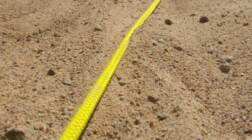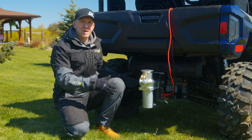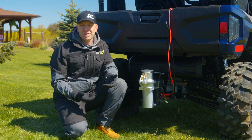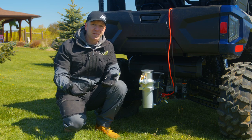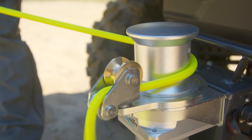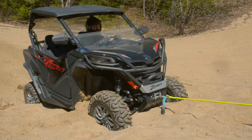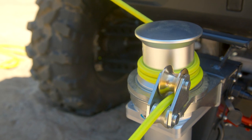Should you want to double that length to 150 feet, no problem. Portability is another advantage — this winch comes in a really nice carry bag and has six-foot leads, so you can use it anywhere you have a two-inch hitch receiver and 12-volt power. You can also get extended leads to use it off the front battery on your pickup truck. With a stall load of 2200 pounds of horizontal pull, the foot-operated switch is easy and allows for single-operator use. All you have to do is pull on the line coming off the capstan and it continues to feed with no limitations of a hook end topping out on a fair lead.